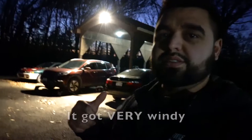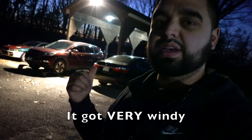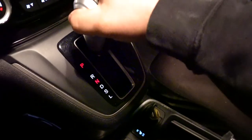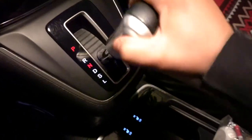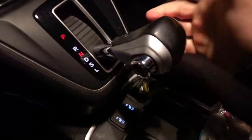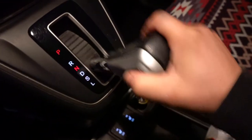We didn't beat the sun but we got it all done. I had to record a lot of it with my phone so I don't know how the audio is going to be, and I wasn't really talking so I'll do a couple of voiceovers to let you guys know what I was doing. Now it's time to take it off the ramps and take it for a test drive. Before you drive it, you want to run it through every gear two or three times — reverse, neutral, drive, sport, low — and then you can test drive it.